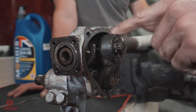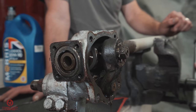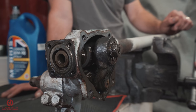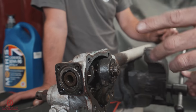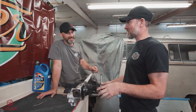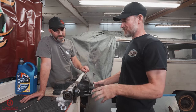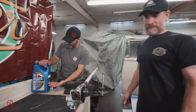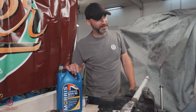When the pin goes across the screw, it'll push any fluid that's on there off. And if it's grease, it's going to push it off and it's not going to come back. It's not going to refresh. But oil will obviously just straight away fill the gap. And we've got a perfect example right here. Indeed, it's the 8090.